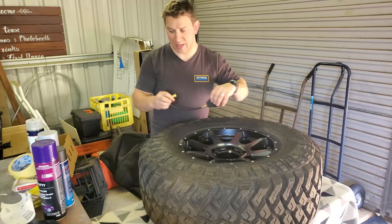Next thing you're going to need is spray putty. It's really good for filling in gouges — whether you've got rim rash from kerbs or damage like mine from rocks. This will help fill it up, then we use sandpaper to sand it nice and smooth for a factory-looking finish. Then you're going to be using some metal primer. I've chosen a lighter color primer because I'm painting my rims a lighter color — a lighter primer makes it easier to bring out the lighter base coat.